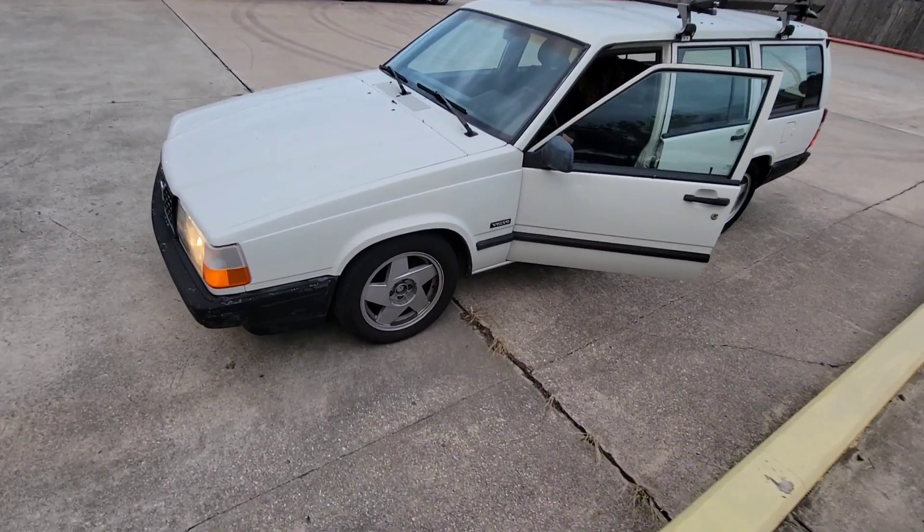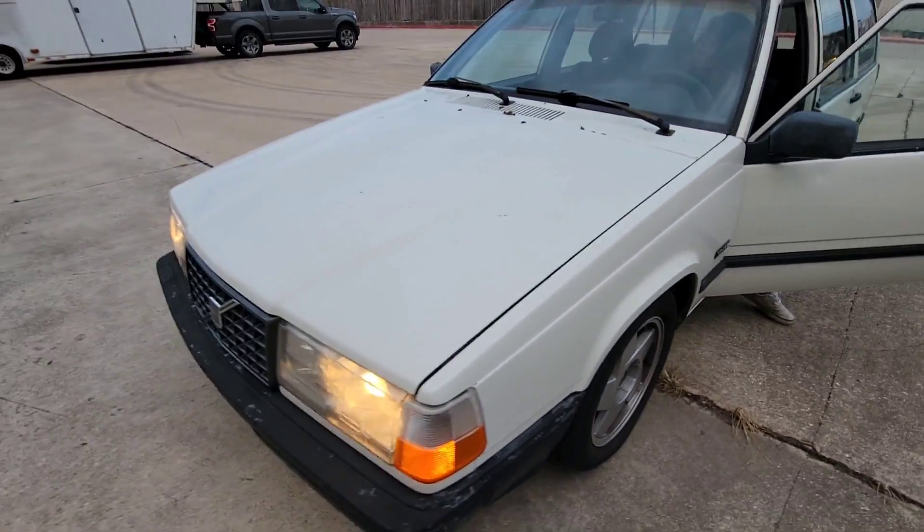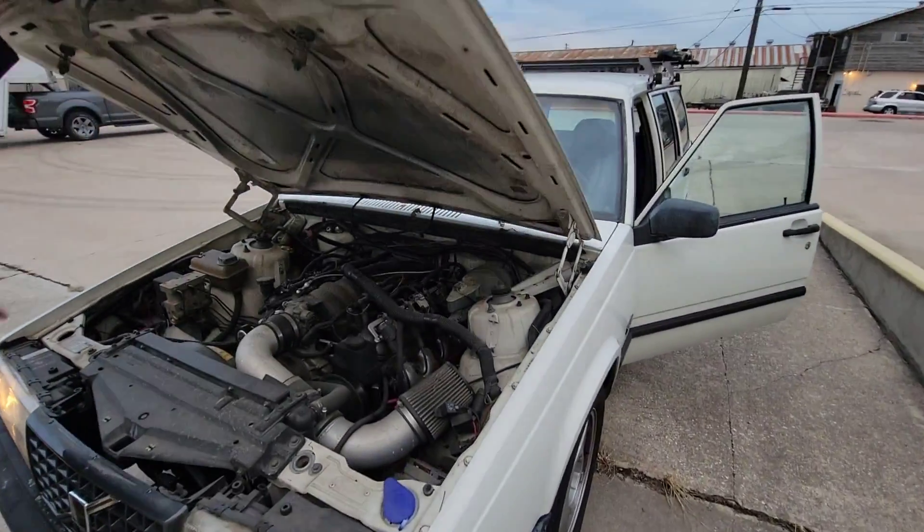This is the man, Sam, and this is his toy. He's the genius behind the computer, and this is not your normal Volvo. Got a little LS in here — it's an LM7, drive-by cable, originally out of like a '99 to 2001. The guy told me it's a Suburban but the ECU identified as a Sierra, so who knows. It's mated to a 4L60, stock rear diff in the Volvo, stock cam, LS1 intake manifold because the truck manifold top wouldn't fit under the hood. He's had it as a reliable daily driver for a couple years now — probably surprises people if you ever decide to mess around with them.